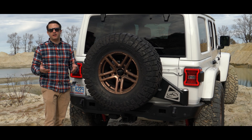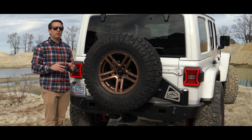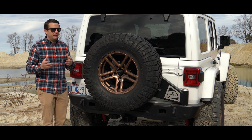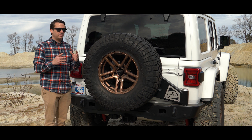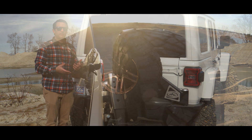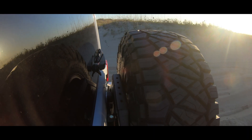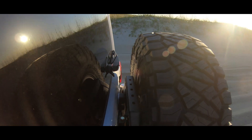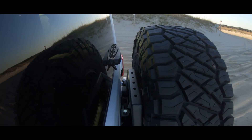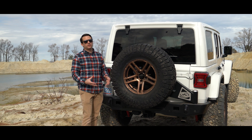After spending about four and a half hours in the garage, we were definitely ready to take this off-road and see what type of improvement we made. We never really knew how much our stock tire carrier was moving until we strapped a GoPro on the back glass and went on the trail — it was definitely surprising to see just how much it would deflect. Since we had a baseline, we did the same thing with the new setup, and as you can see in the video, it is an absolute night and day difference. Unless you're hitting a really big bump, there's not a lot of movement. We attribute a lot of this to the fact that the tire carrier and entire swing arm assembly is now resting on a two-bearing swing arm bolted to the bumper, with six bolts going to the chassis.